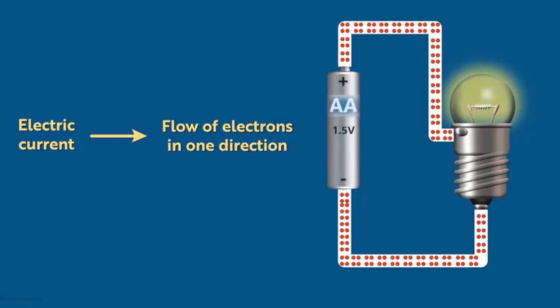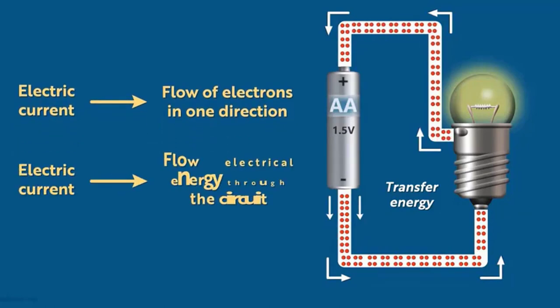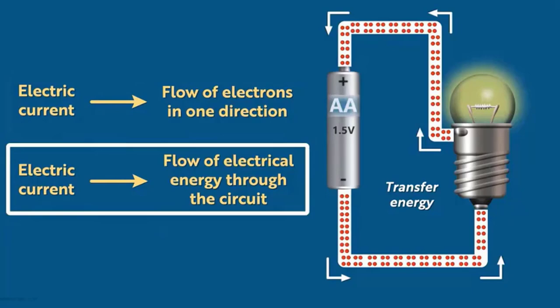As the energy flows through from the passing of the electrons, it'll go through that filament. That filament is a resistance, and it's such a resistance that it will actually heat up to a point where it will burn and cause it to light up. It's really the heat that causes that bulb to light up, and it will go back to the source through the battery, and eventually it will drain that battery down as the electrons flow from the negative to the positive, contrary to what most wiring diagrams and what we used to say and think.